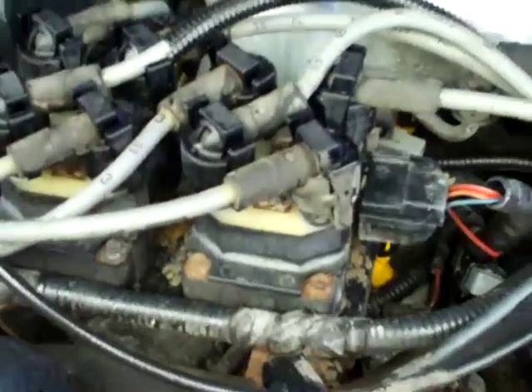Checked up here, cleaned the battery cables, cleaned the coils — you name it, it wouldn't start. Tried starting fluid, wouldn't work. Turns out it was the infamous inertia switch, which is right here. What that does is if your vehicle rolls over, it's supposed to pop and shut off fuel supply. Somehow that got tripped while we were draining the transmission fluid, so I thought it was a short somewhere under the hood, but that's what the problem was.